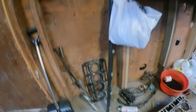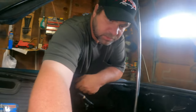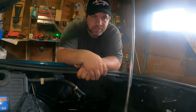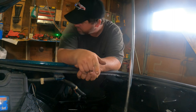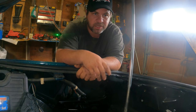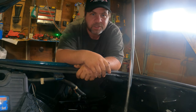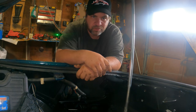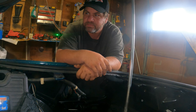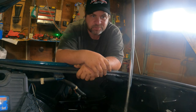These heads, man. I've been told that with these LM4s, you want to pretty much keep the stock heads. If I'm not mistaken, these are 862 heads. Once I get this block painted up, I've got to order some new rings — they were pretty rusted in there, I actually broke one. Rings are cheap, so might as well just throw in a new set. While I'm waiting for that stuff to arrive, I'll go to work cleaning these heads up and see how they come out.